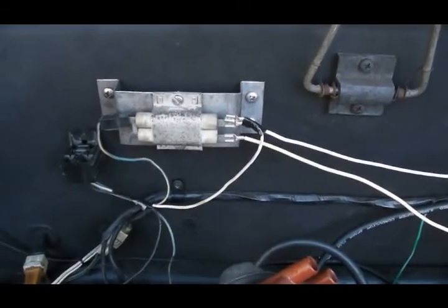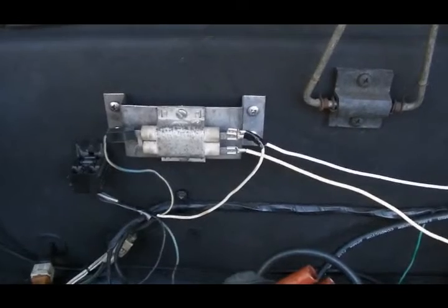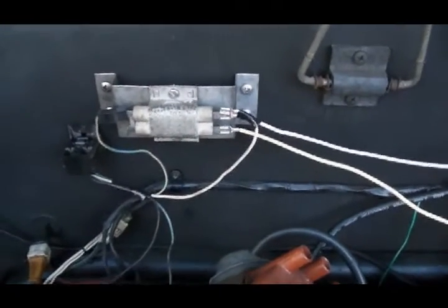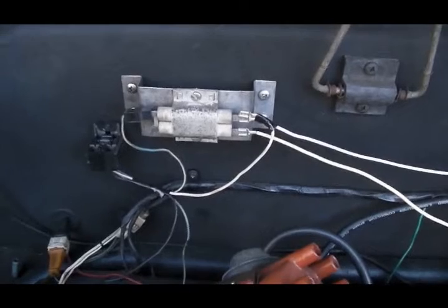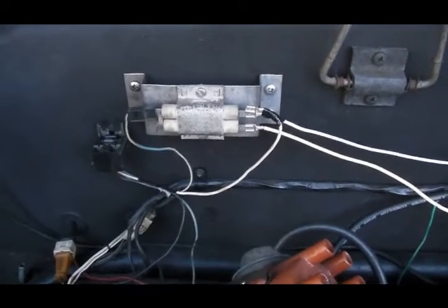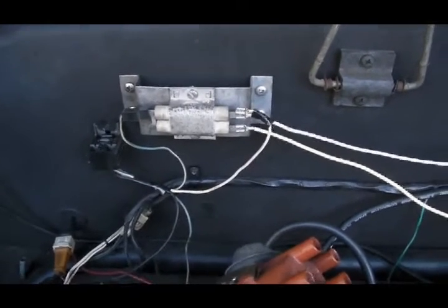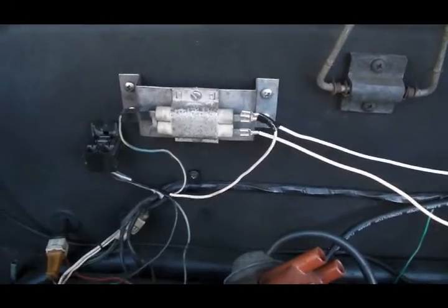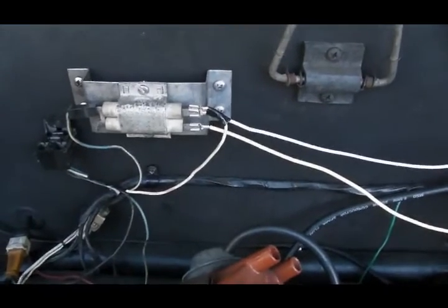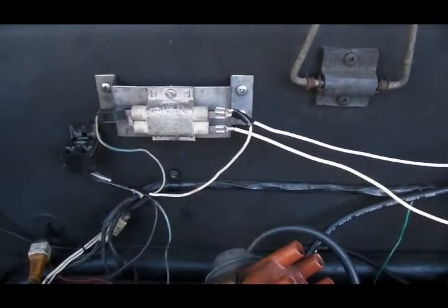Let me point out that every once in a while you'll run into an owner who insists that the resistor grid will only work if the white terminal is on one of the two resistor grid terminals, and the white with yellow is on the other, and that if they're reversed, your ignition won't work. That is incorrect. The resistor grid is not polarized - it's not polarity sensitive. It's bi-directional; it works in either direction. You could put white on the top and run around to white with yellow on the bottom, or put white on the bottom and run up to white with yellow on the top. The resistor grid will work identically in either direction.